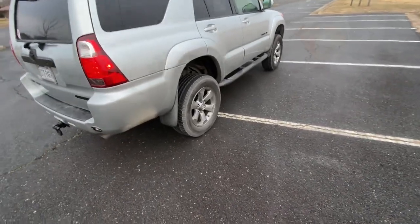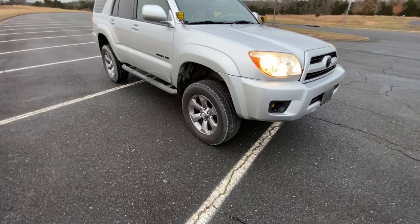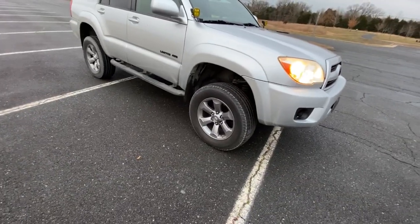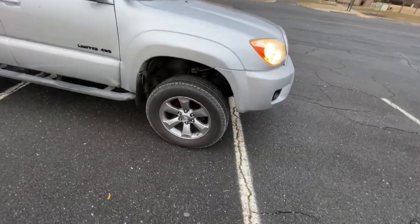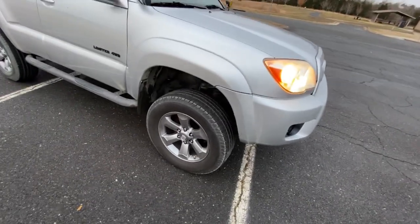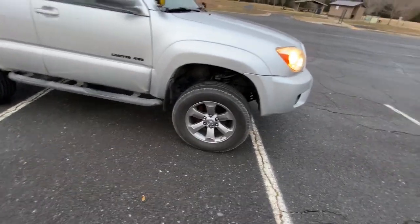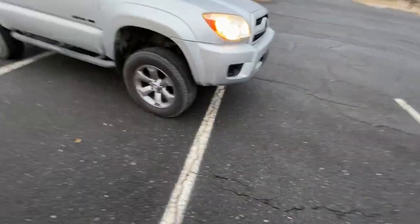Let's get into suspension. I didn't want to break the bank — I did tons of research, probably spending six months deciding what I wanted when I got serious about buying. I heard nothing but great reviews on Old Man Emu, so I went with Old Man Emu. I believe these are the 885 front coils and struts — the mid-tier rigidity option. I'll link it in the description. With the V8, I wanted a little more rigid support for the extra weight, and eventually I'd like a steel bumper, so these should handle that long term.